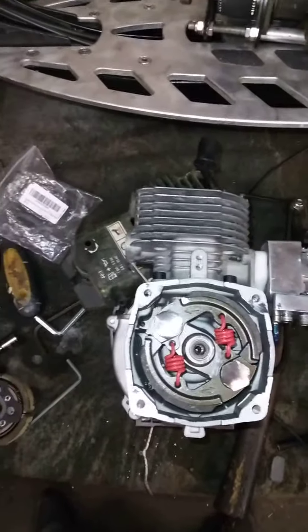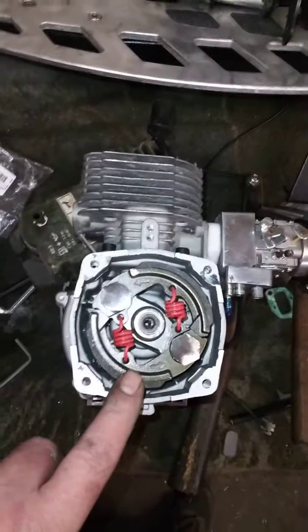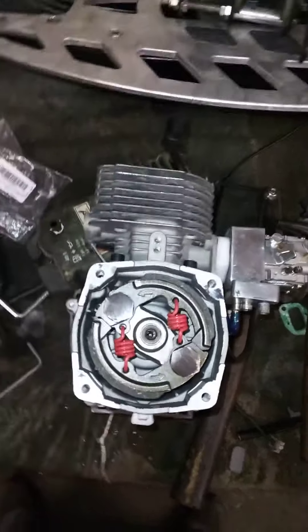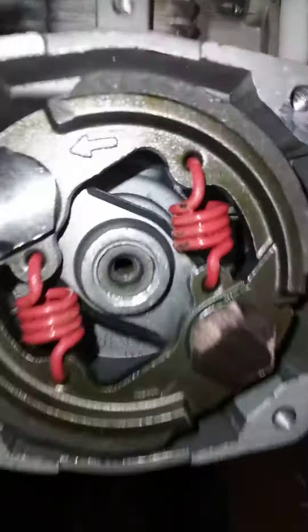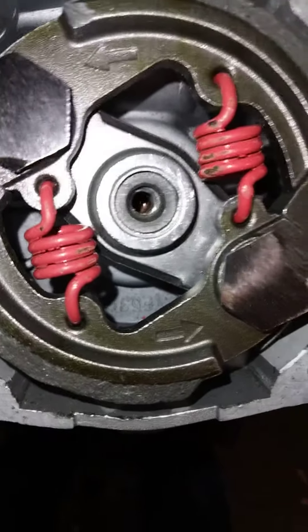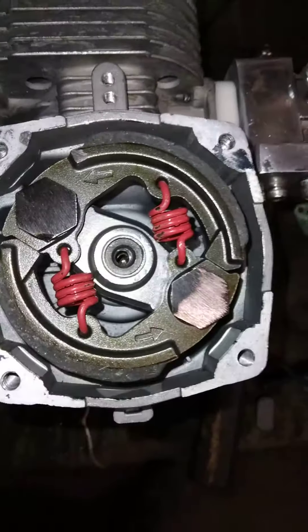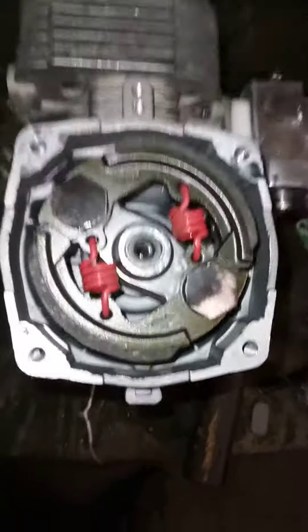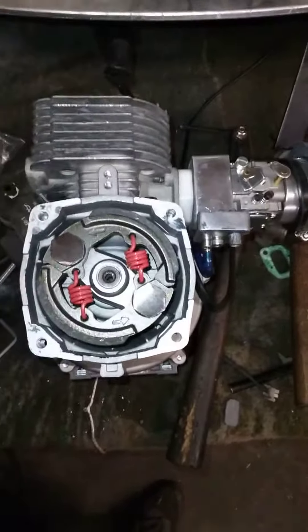Thanks for watching. Just wanted to share that little bit of info in case you wanted to tackle this at home. You're gonna have to put the same kind of clutch as you have on the 63cc. Another bit of information — if you can see it back there, the crankcase is stamped as a 1E53F. So I think that this is the same crankcase as the 63cc, but maybe you gotta buy the whole engine to convert it, which is just as cheap anyways. All right, thanks for watching guys, and I'll be doing more videos here in the future.